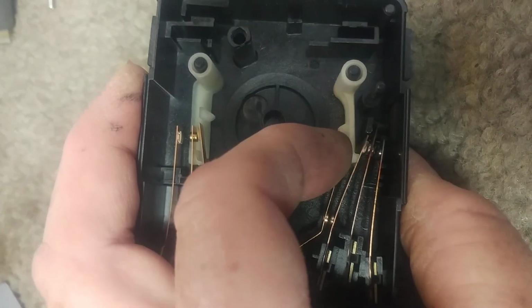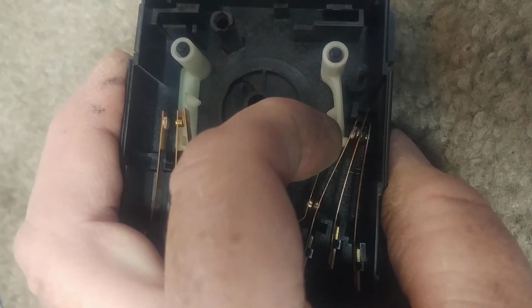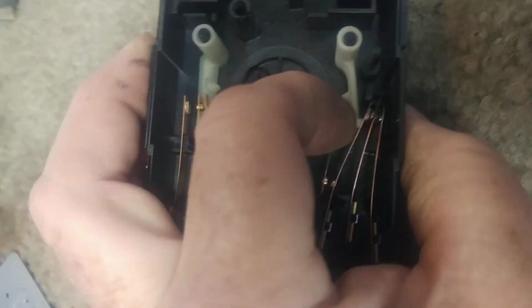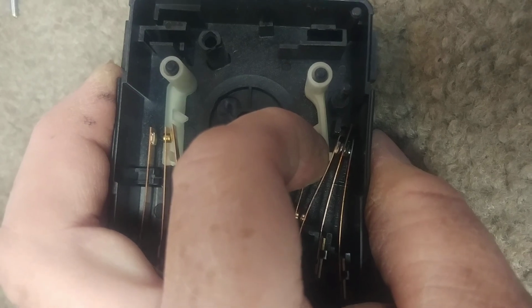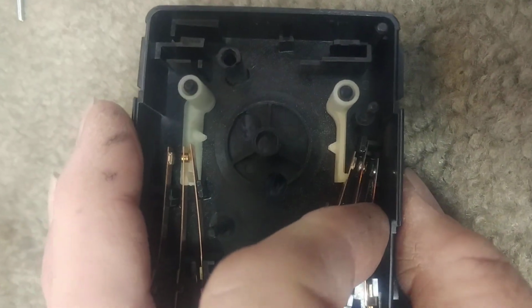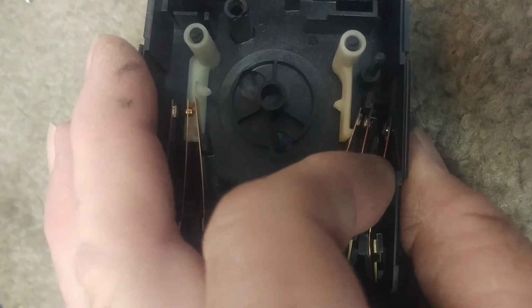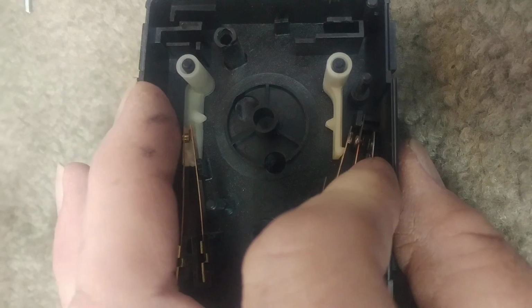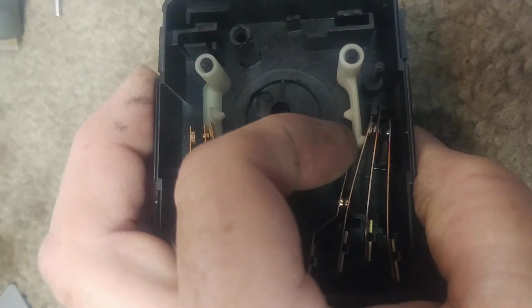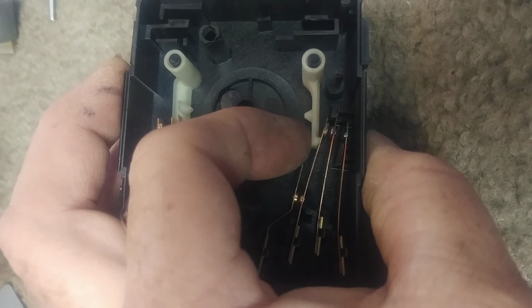from heat, because this lever has not been pushing these contacts far enough. And if I push this hard enough, it'll break loose, because it's kind of from heat glued to the plastic post back there. This contact should be able to move, and there you go. See, it's now loose because it got so hot that it melted itself to this plastic stop. So this is how they're supposed to really work now that they're free.